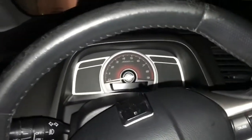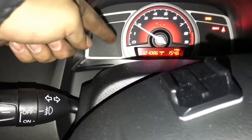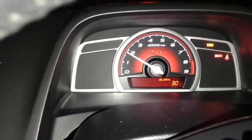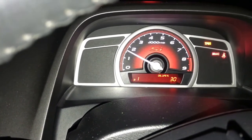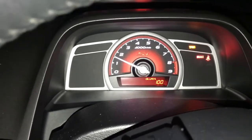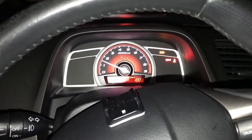Now that we got the oil changed and everything is ready, let's start the car up. I didn't have the maintenance required light because I changed it at 30 percent — you can do it at 20 but that's fine. To reset the oil life, hold the reset button. Once it starts flashing, let it go, then once it's still flashing hold it again, and in a couple of seconds it should reset itself back to 100 percent. 100% — that's about it! Thank you guys for watching, make sure you hit the like button and subscribe, and we'll see you on the next one.